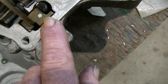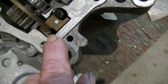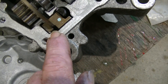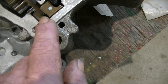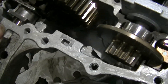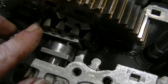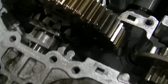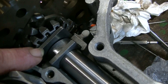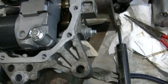The brake pucks fell out too — there's this larger piece here and this little guy here. You can tell from the face of them which way they have to go in; there's a wear pattern on them. Down in there are keepers, and inside of that are c-clips, on both sides of this differential, and of course some of that fell out. I've got it back in.